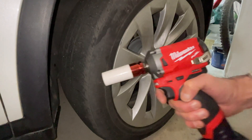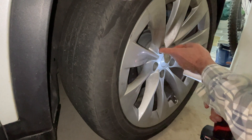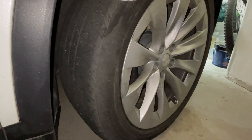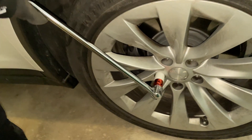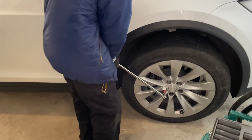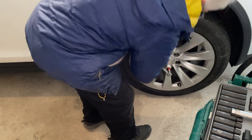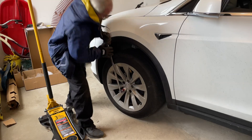To do that you will need a 21mm impact socket. We tried taking these lug nuts off with an impact driver because, well, impact drivers are fun and cool. But the problem with impact drivers is that by the time they break the nut — which is fancy talk for loosening it — they will basically zip it right off, or at least loosen it far too much. That's why a dedicated breaker bar is a far better tool for the job. A breaker bar will just loosen a lug nut by a quarter or a half turn. Dave likes to break all of the lug nuts from all of the wheels while the car is still on the ground, which makes a lot of sense from an efficiency perspective, but only if you have a breaker bar.